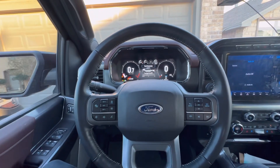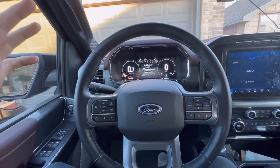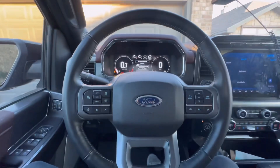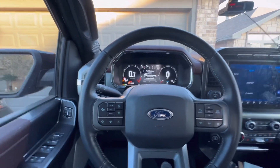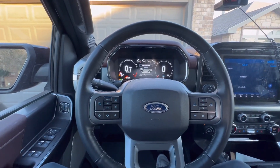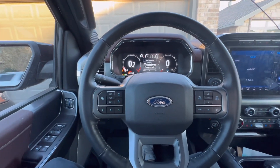On the road trip I had to drop it back to the 91 octane tune because of available gas, and it was still phenomenal — it would have been even better on the e30 tune, but finding E85 on a road trip isn't very feasible. The 91 tune was still flawless. Cruising at 90 mph in a 10-speed transmission, you're in 10th gear at about 1,700–1,800 RPM — that's why the gas mileage is so good.